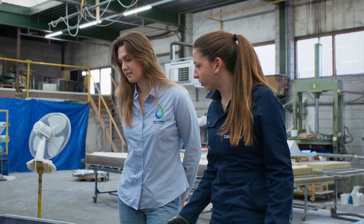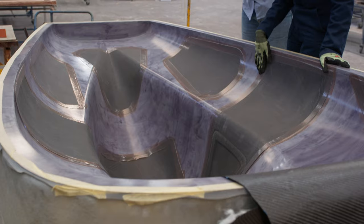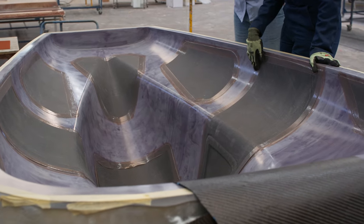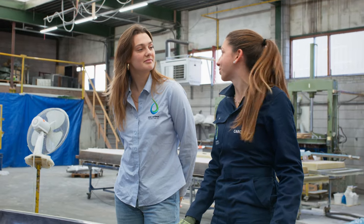I see a lot of separate elements in here — can you tell me what they are? Yeah, so these are actually all the doors and panels of the car. We decide to do them beforehand because by laying the prepreg carbon fiber on top we create a flange, and at the end of the process we just glue all these panels to the shell through this flange to make sure there are no gaps, so the shell will be as aerodynamic as possible.